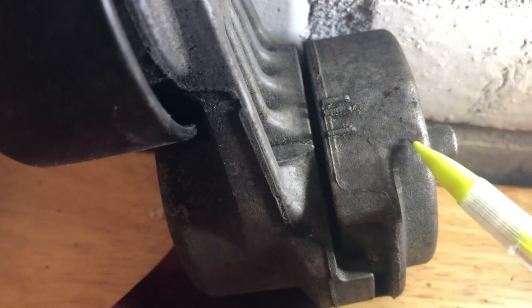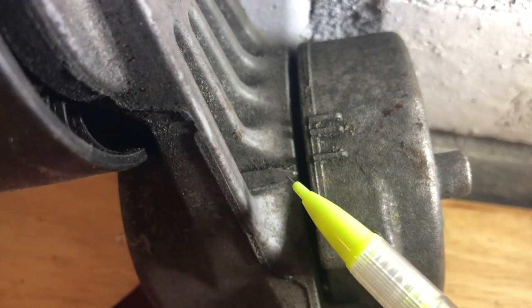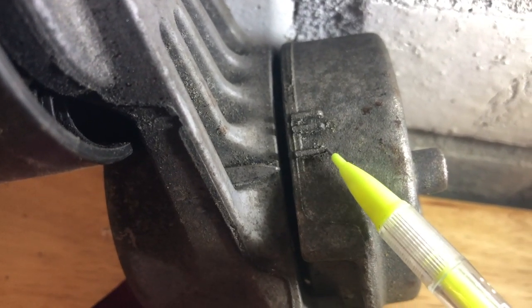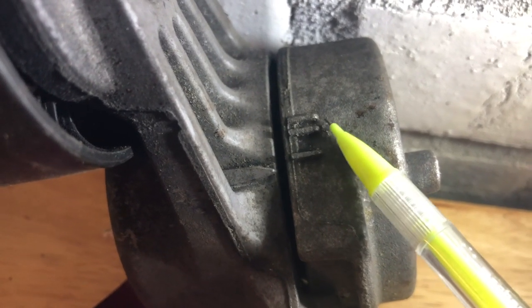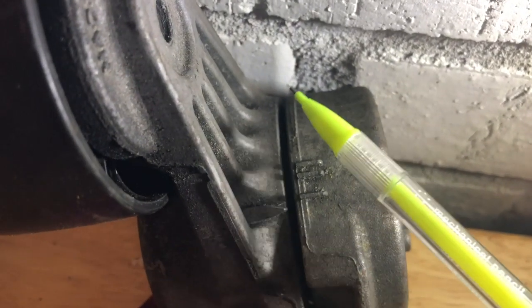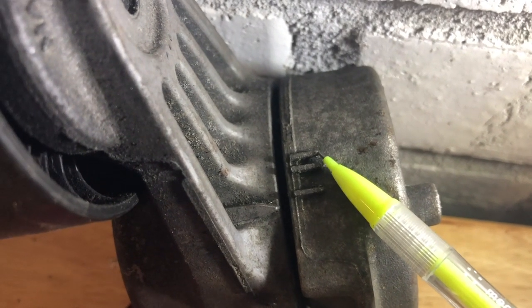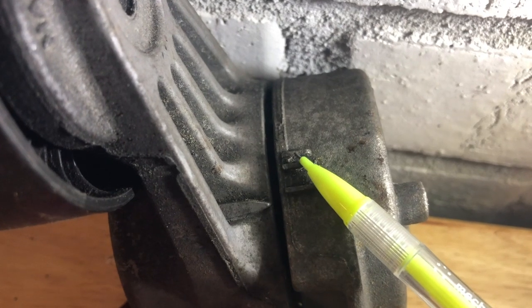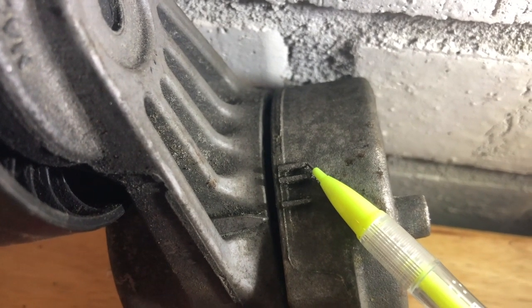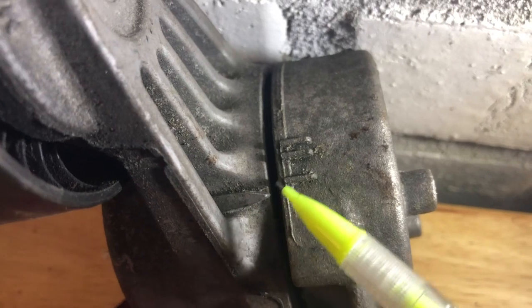This section is bolted to the engine and can't move. This is the bit that swings backwards and forwards trying to tension the belt. There is a pointer just here and there are three markings. Two of them are close together — those are the good markings. One is on its own — that's the bad marking. When the belt goes on, the pointer might be touching that first one — that is the tightest the belt could be, the shortest it's allowed to be. It's allowed to stretch until it gets to this next marking.